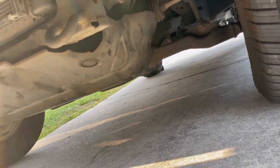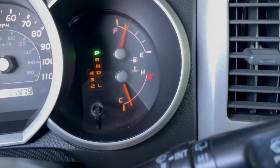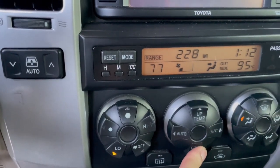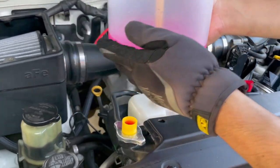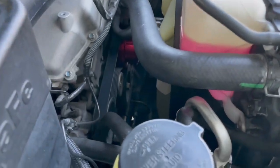We want to check to make sure that there are no coolant leaks. I tightened back up that little valve when we drained the coolant, but I always want to check. So far there are no coolant leaks, which is pretty good. I'm also checking the temperature and it's not spiking up to hot — however, it's only been running for a few minutes. There are no check engine lights, which is pretty good. Since it's not spiking hot I'm going to go ahead and turn off the heat and then turn off the engine. Since there are no air bubbles, I'm going to plug up that funnel, open that cap, transfer the coolant over to the reservoir tank. Reservoir is at full — everything is good. The new pulley and the belt is in. Thank you very much, Adam, and thank you very much, Christian — greatly appreciate your help.